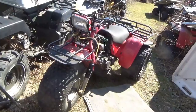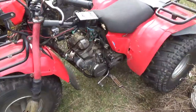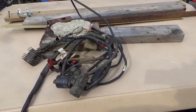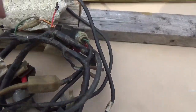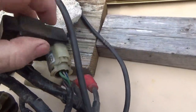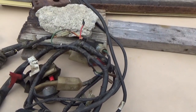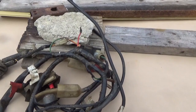Welcome back for another adventure. This thing has an ignition issue and there are a few ways around it. To get it running, I initially put a portable CDI box on it. After that I went back to the OEM ignition system, wired it all up, pulled the CDI out, checked the ohm values for all those points, and they were what they should be. I put it all back together and it wouldn't start — no spark.